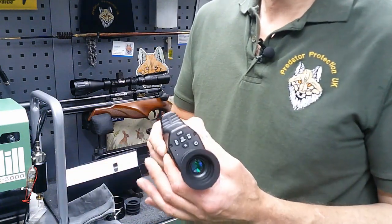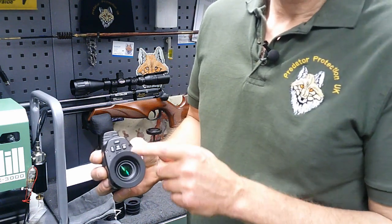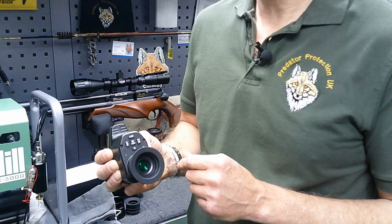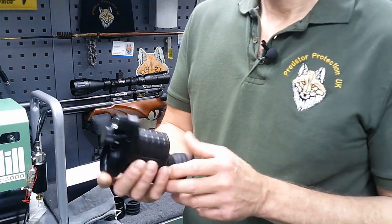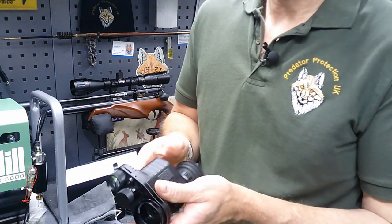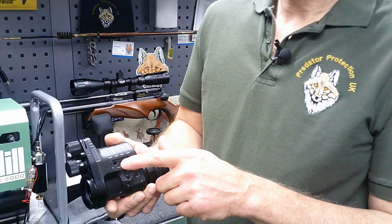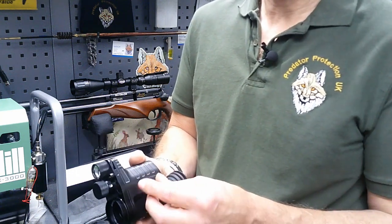What I did like about this is the control panel on the back is very easy to navigate, even in the dark. The main power button is situated far over on the right-hand side, and then the other four buttons go across. Your main menu is on the right-hand side at the three o'clock position. At the nine o'clock position is the one-touch button to switch from full daytime colour HD over to black and white, and then repeated presses of that button will brighten or dim the IR illuminator. At the front, pulling the ring in and out gives you the flood or pencil beam effect. On the side of the unit there's a little trap door where the memory card sits — it comes with a 32 gig card. There's also a micro USB charging point and a 3.5mm jack socket so you can put an earpiece in and play back the video and listen to the audio recording. Quite a nice feature.